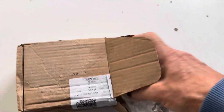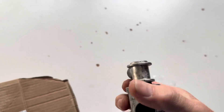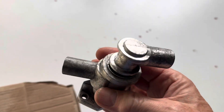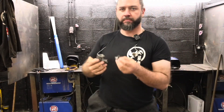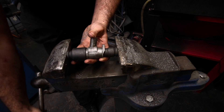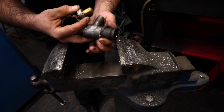Just arrived back from Bob at the machine shop is this air slide valve from our 450 SL parts car — this is ready to go back on a 450 SL or 350 SL. I've uploaded a separate video showing him repairing this, but I will include that footage now at the end of this video. Our auxiliary air slide has just arrived with Bob at the machine shop and the first thing he has to do is press out the thermostatic bulb. We've already pressed out the piston. You can press out the last bit using just a vice, but to actually press the piston out and put it back together you are going to need a hydraulic press.